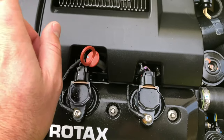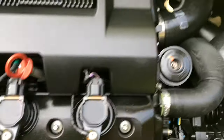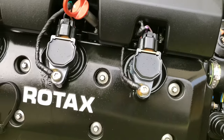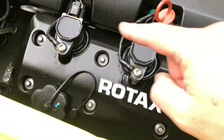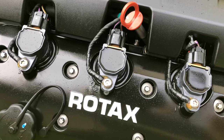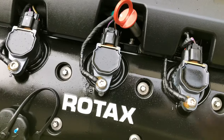We're going to remove the dipstick and then siphon the oil out of the engine — we're doing an oil change, then replace the filter after the oil is completed. Then we're going to remove the coil packs, take all the spark plugs out, fog the engine, put in new plugs, and redo all of our connections and clean things up.